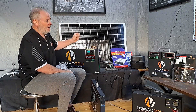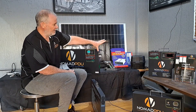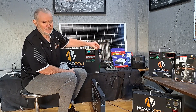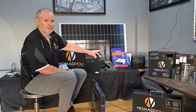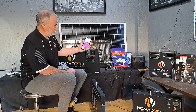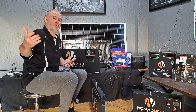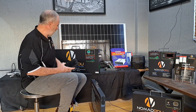These have been very, very popular and will do pretty much everything you need. If you're going to run things like travel buddy ovens, make sure you cut the cigar plugs off and use Anderson connections — they're much better. You can run wire leads out of this, even a triple wire with three fridges running. Just remember the output is maximum 50 amp — don't exceed it. It's Bluetooth enabled, so you don't need a hardwired battery monitor in the front of your vehicle.